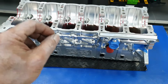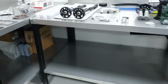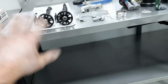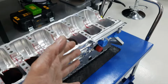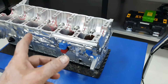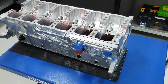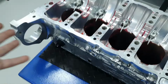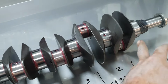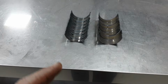So he spun it 20 times by hand. Then when it came time to set up the timing for the camshaft gears, he did another 10 times, for example. That's too much, I know, I'm just saying, 30 times. I also spun it yesterday another 20 times. So that means we spun the crankshaft 50 times by hand, without oil pressure, fine. And before, you see it was full of assembly grease actually. I just wiped it to get some measurements, all right?